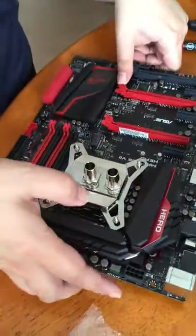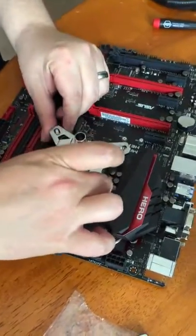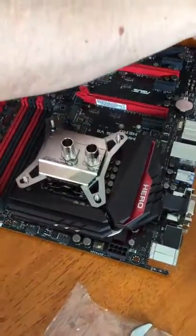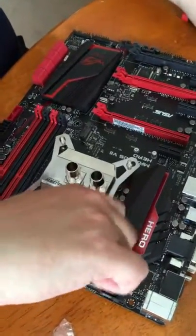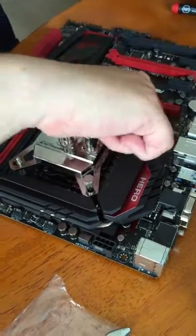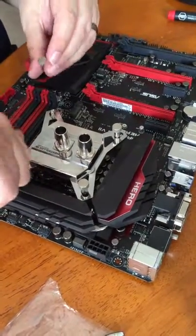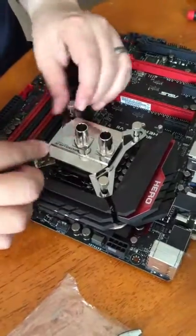You may read on some review sites about a goofy fitting — what this basically means is the block is rotated by 90 degrees and fitted sideways. We will be using a standard fitting as it doesn't seem to make much difference on this block. I'm just going to screw the fasteners straight down. We'll add the metal washer and the springs later once we've leak tested it — at the moment this is just so I can line everything up in the case, fit the pipe, and make sure everything fits together as it should.